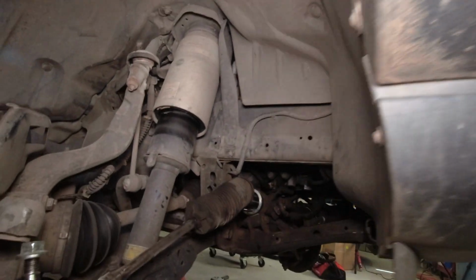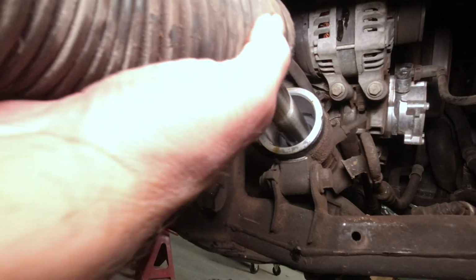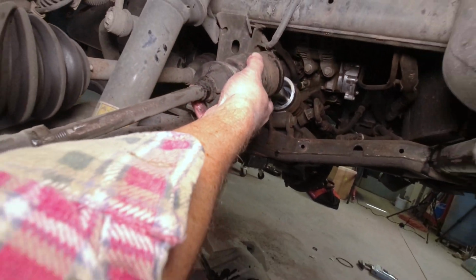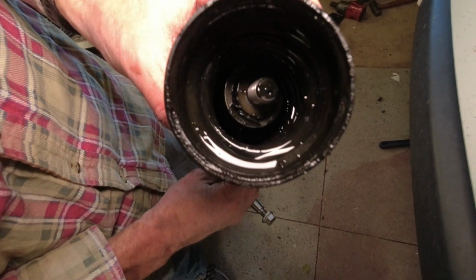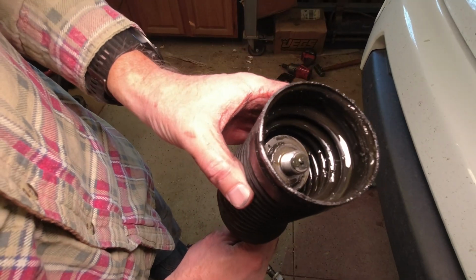So bad news, there is oil fluid coming out of this. Whoa, whoa, whoa. That's a ton. It's all in this boot. Oh my gosh. So we have a problem. There is a leak from the steering rack. That's a really important component. That's where the steering wheel column comes down and it controls the steering of the car. If that breaks down, well, you can die.